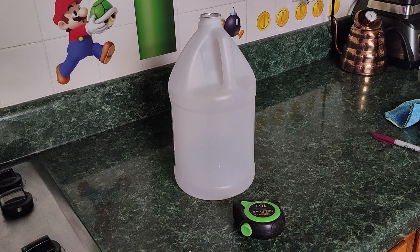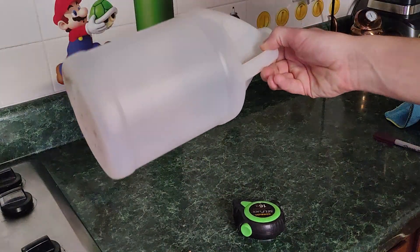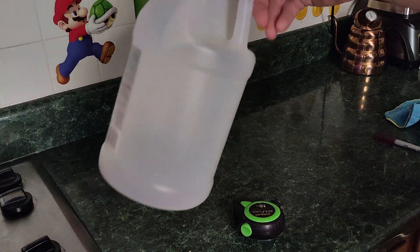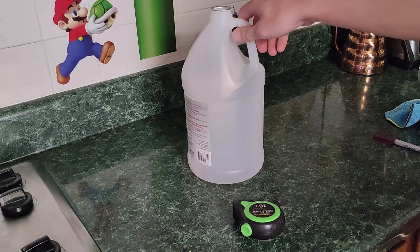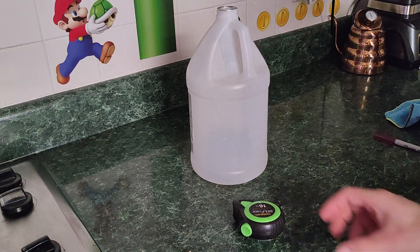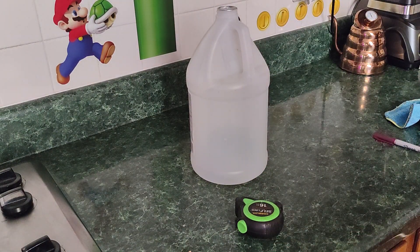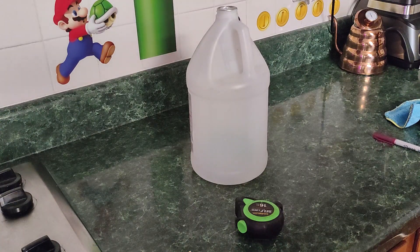Boost juice was a big debate for a long time — is it 50-50 or not? I tested it, and it was not 50-50. So what I did was retake a standard windshield wiper jug. It doesn't matter, they're all the same. This one just happens to be from Old RV Marine because I actually needed it during the wintertime. Then I measured out and verified with the hydrometer exactly what 80-20 and 50-50 would be.